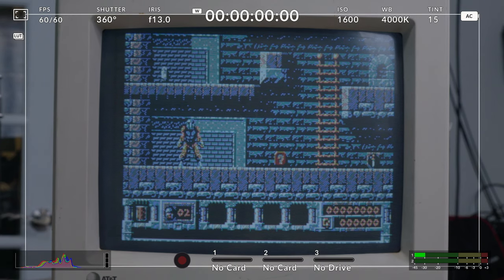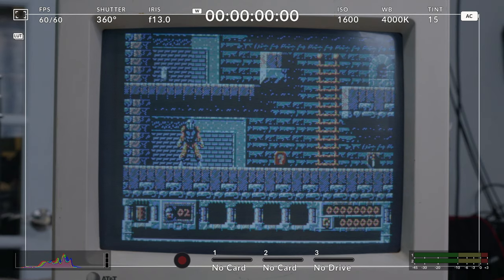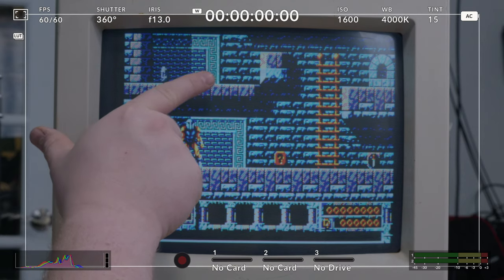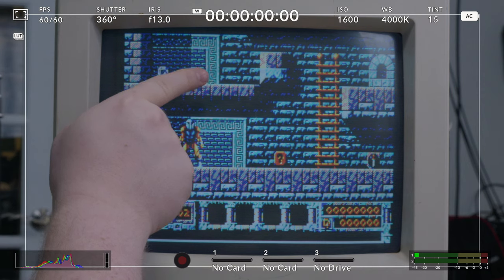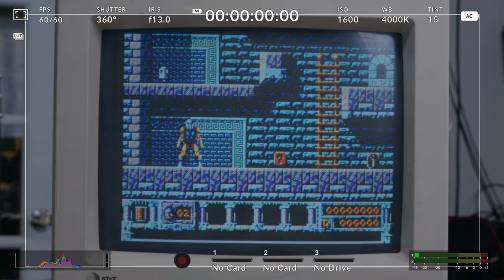This is the base 16 color CGA palette. So we're looking at just red, green, blue and their combinations and intensity. This is BBC Micro 3-bit color. So there's no intensity. It's the exact same image, except that instead of having a bright and a dark version of every color, there's only the bright version. So for instance, up here, we've got what appears to be a dark and a bright cyan, but what's really going on is that that's just the blue bit on the bottom, and then the one above it is blue and green at maximum intensity, so you get cyan.